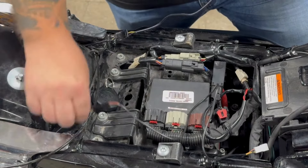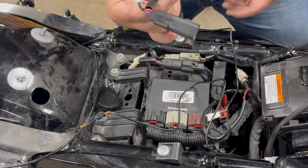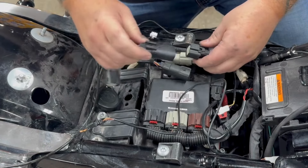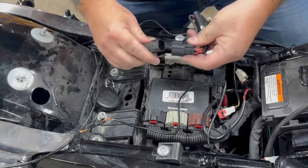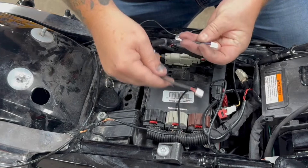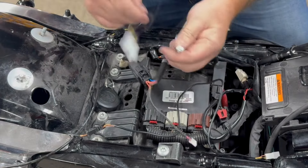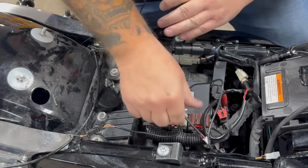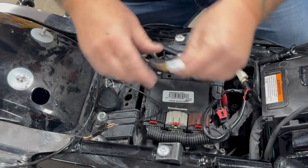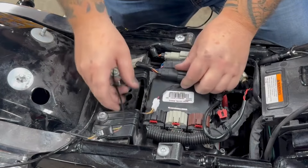I'll do that on the other side, and then we'll run the wiring up. I've run the wires up in between the fender rails and the fender. I'm going to get our plasma rod adapter harness — the stock harness is right here, the black one. Unplug it. Simply run in line with it, and then the two pigtails: violet and brown. Violet is the left side, brown is the right side. Simply plug those in, and then use your cable ties to tie these wires up so they don't get frayed or cut. And that's pretty much it with the harness.